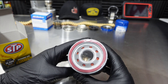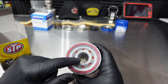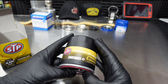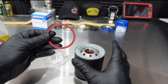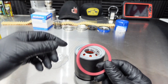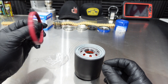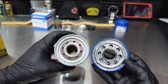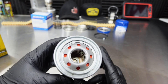Looking right into it, we've got the plastic to keep debris out, and inside, this is the only filter in the PF66 range that has an actual bypass relief valve inside of it, so I'm curious to see what that's all about. Right off the bat, you can see the silicone seal right here, which is already a fantastic piece. The reason silicone is better than rubber is because it can withstand heat and cold better — good down to negative 40 degrees Fahrenheit, up to 400 degrees Fahrenheit. Rubber is nowhere near that.